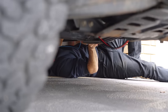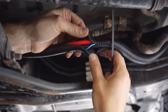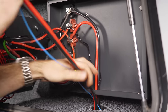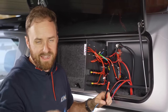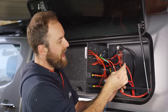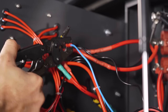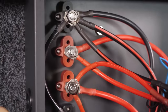Every vehicle is different, but make sure you route your cables out of the way, away from anything moving or hot, and ideally use some corrugated tubing to give it an extra layer of protection. A couple of cable ties along the length of your vehicle will keep it tucked up and out of the way. I've run my wiring from the starter battery underneath the vehicle, put some corrugated tubing on it and cable tied it up out of the way. My last three wires to connect: the blue one connects to the blue wire on the back of the DC-DC charger, my red one from the starter battery connects to the middle terminal post, and the black one connects to the black terminal post. As always protect your crimp joints with heat shrink, then ensure you arrange the terminals, then the washer, then the nut so everything can be tightened up securely.